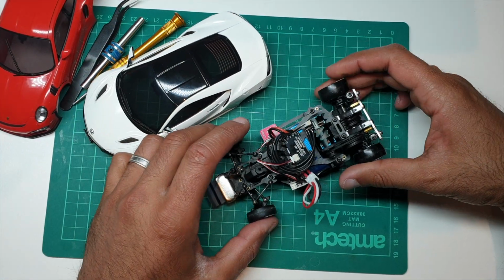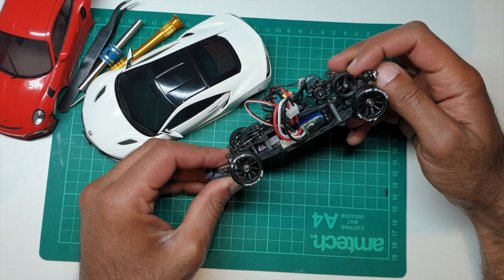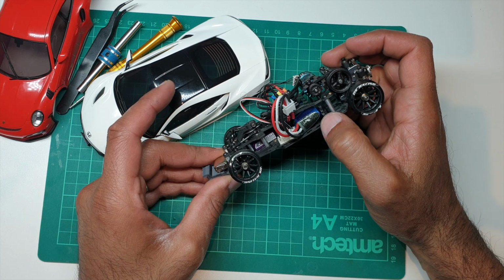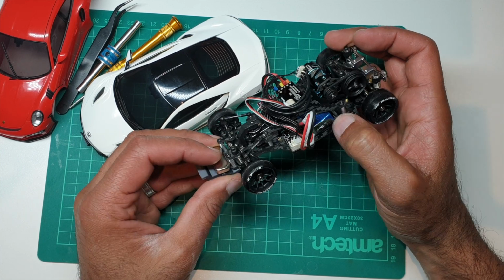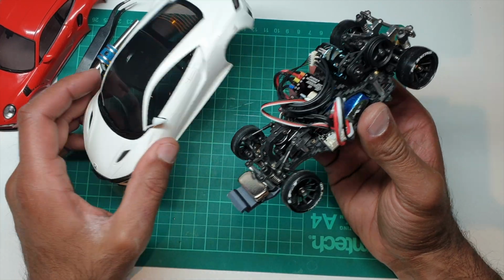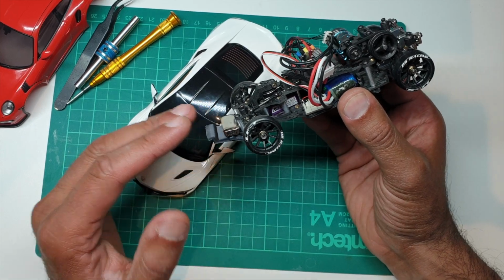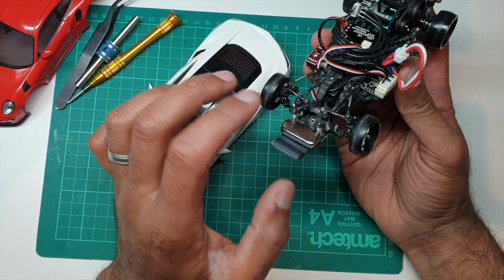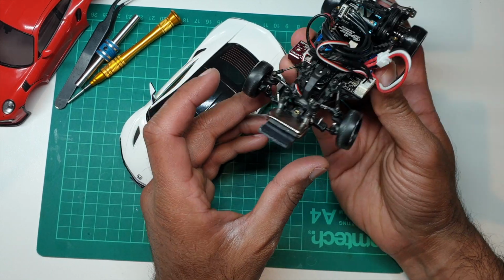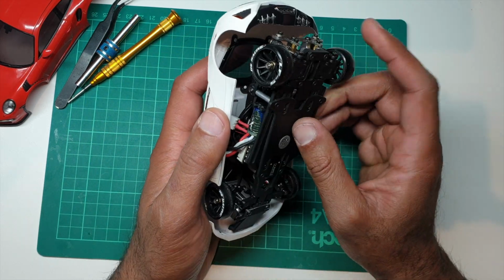That's better. So yes, with the rear spur wheel there, the belt rubbing against the chassis, I had to mount the shell on the higher one. And that also helped with the front, but didn't completely solve it for this NSX shell, so I had to 3D print a custom mount to lift the nose higher and then adjust all the settings on the suspension so I could actually drop the car down so it didn't look like it was riding in the sky. I managed to do it, but it was a bit tricky.